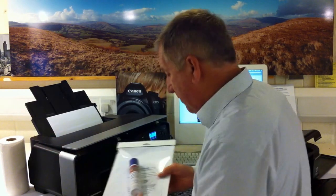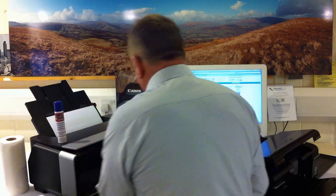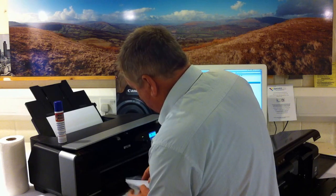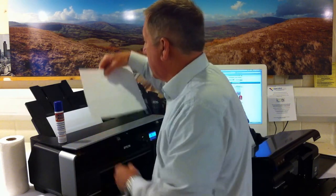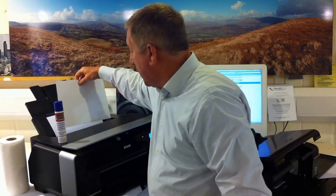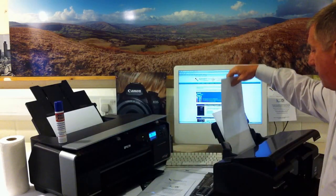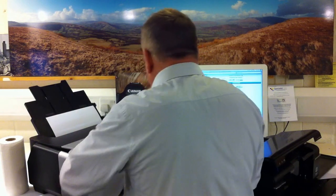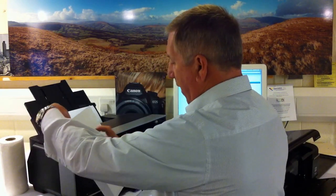You simply take out the pump action aerosol — it's a non-pressurised can. The kit comes complete with six little cleaning sheets that are A4, which means you feed it in landscape in an A3 printer, and you feed it in portrait in an A4 printer. You prepare the cleaning sheet by simply spraying the front.